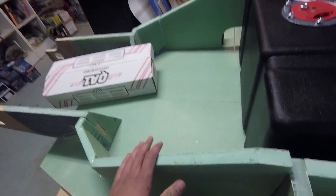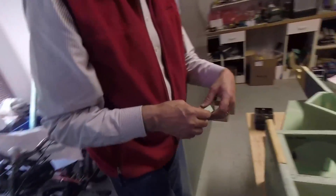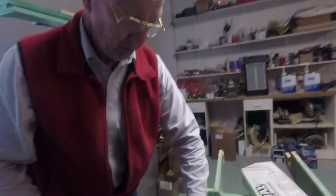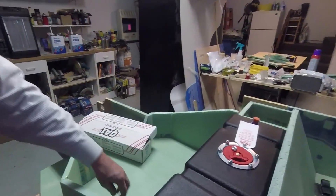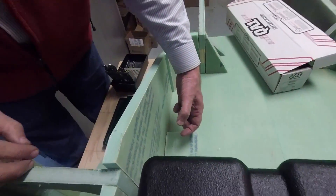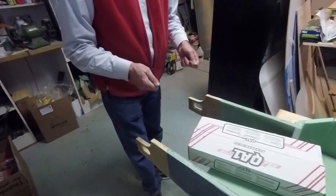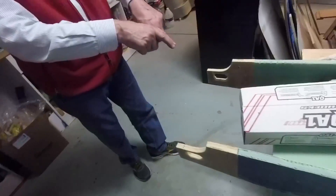This will be durable enough to mount the engine and transmission once the whole assembly is there. There are a number of small parts that go in here — they'll stack up, the engine mount will sit on top, and there'll be a bar that runs across from one side to the other bolted onto the front of the engine. You'll have a rubber donut on top of that and the engine mount bar going across. In the rear where the axles come out, the top of the transmission will be mounted to a steel subframe. So you'll have three mounting points: one in the middle at the top in the transmission area, and two on each side up at the front of the engine.